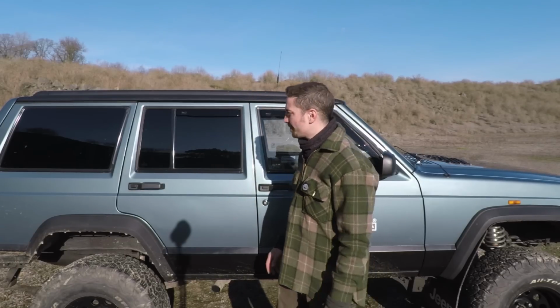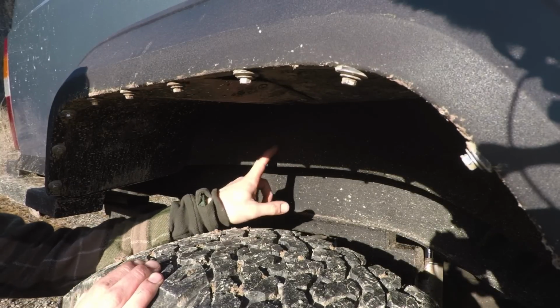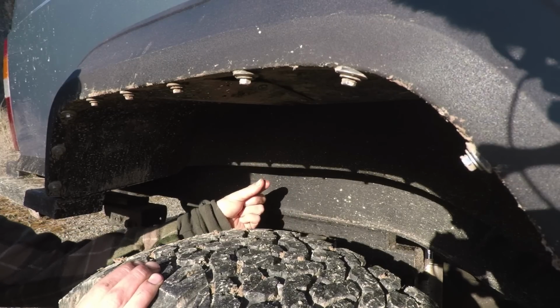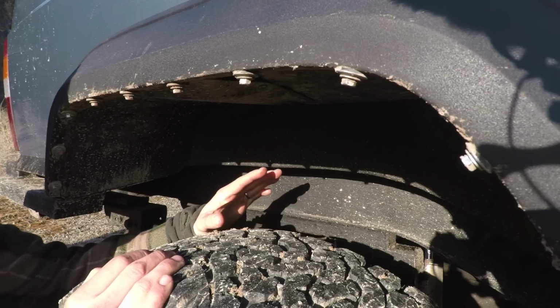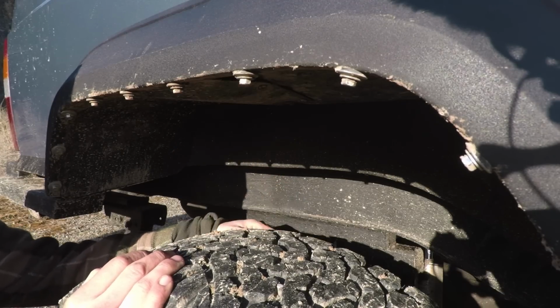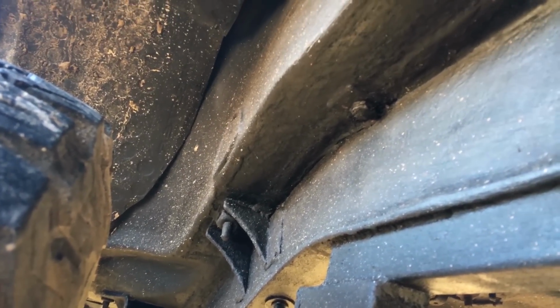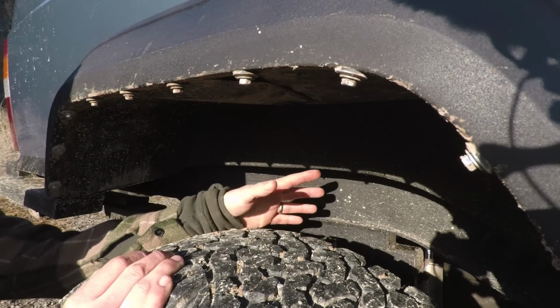A change I always wanted to do was eliminate the flange here that connects the wheel well to the floor pan of the actual boot. You usually have a lip of metal, much like you do on the sill. Problem areas on all old cars, you end up with rust building up between them because the paint in there is very thin. I continuously welded on the inside of the arch and ground this all the way around, and completely got rid of that actual lip there, so that no water or dirt can ever get in there again.